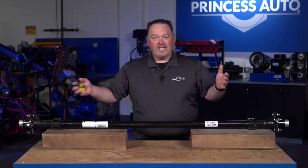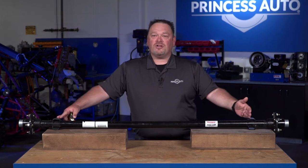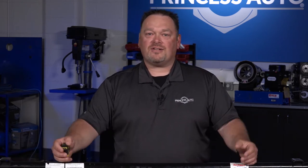That's your basic way of measuring a straight axle. Now, if you don't get this right — if you don't measure your spring centers to spring centers properly — you may have to build in gussets in your trailer. That's why it's super important to start with the axle. Once you have those dimensions and get the size of axle you want to use, you're basically just taking the measurements off of that. That allows you to line the axles up to the main frames properly without any twisting or adding extra material, or rebuilding your trailer in some cases.